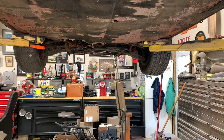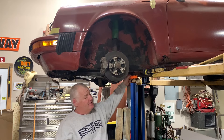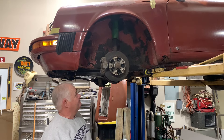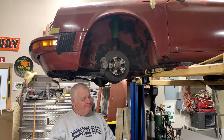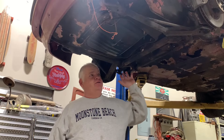Let's sweep up some of these Porsche parts. A lot of weight reduction going on tonight, guys. I've gotten about 10 pounds of rust out of this thing. Looks like I've got some more work to do — some of it's not so bad, some of it's going to require some work. Get ready to drop this front suspension and start cutting this suspension pan out and the tank support, putting that stuff back in. I've uncovered quite a bit more rust in the fenders, in the upper fender where the fender mounts to the front of the body, and down in the firewall area where the fender meets the firewall. It's going to be fun — we're going to make those parts, repair it right, and get this thing back on the road.